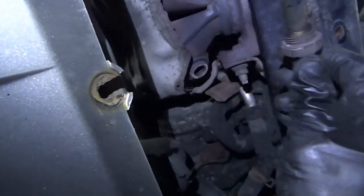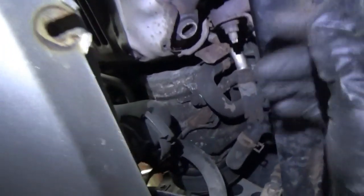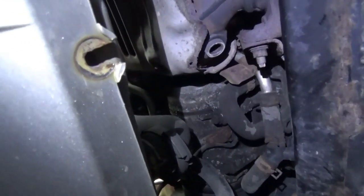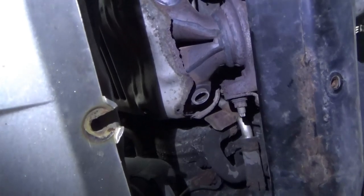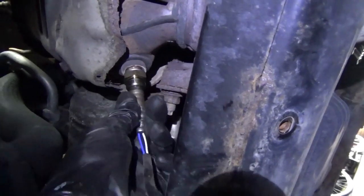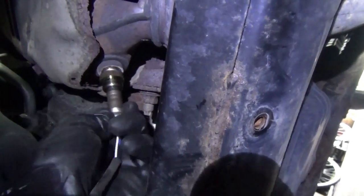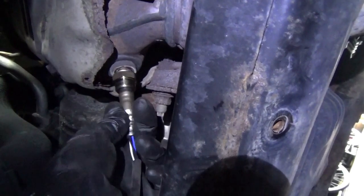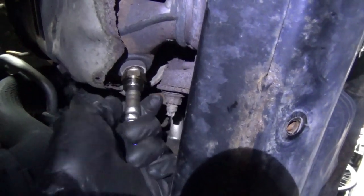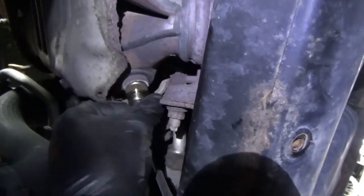This is our guy with the burned out heater. I guess it's original, I don't know. Let's shove the new one in there with some anti-seize and fire up the scanner. Shiny new. Even though the cat doesn't work. On Toyotas, these downstreams are usually pretty important for the overall fuel mixture. That strategy is not trivial. So these still need to work.